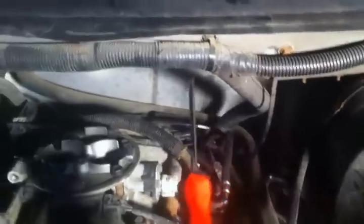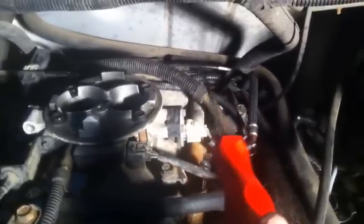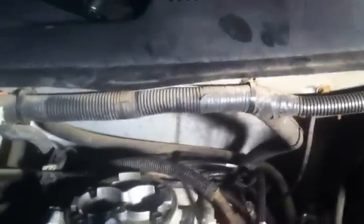Then what I do, and it doesn't take me too much longer, and it's just as easy, is I run the wire up, and I actually plug the new wire on that old crappy distributor cap, okay? Now, what that does is allow me to just leave that thing hanging around in there for a little bit, and I run all the wires, I get them all nice and neat, like I like to run them. They shouldn't touch anywhere, okay? And then they cross over in the back. Back up in there, they kind of touch and stuff, but that's what that plastic's for, okay? It protects it. All right, so now you got them all hooked up to the old distributor cap up here,